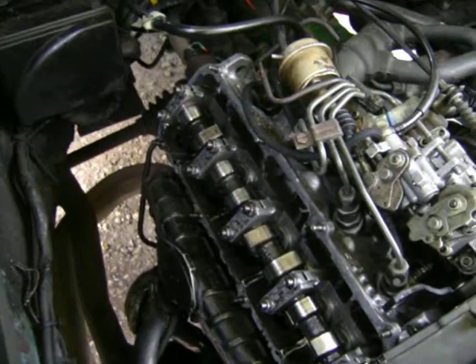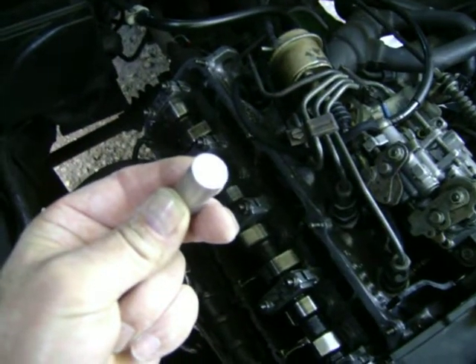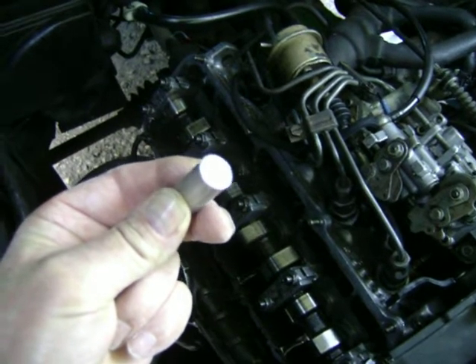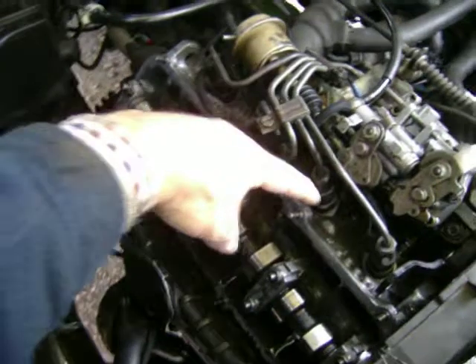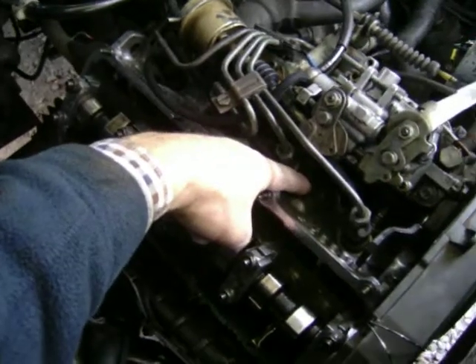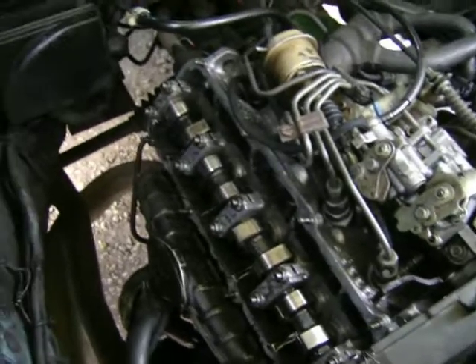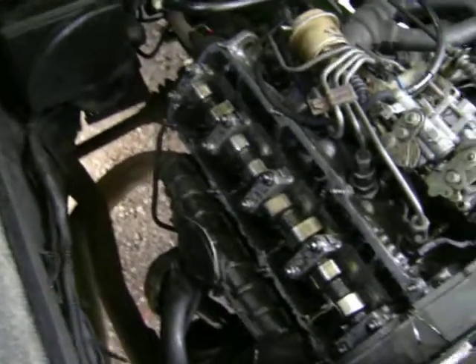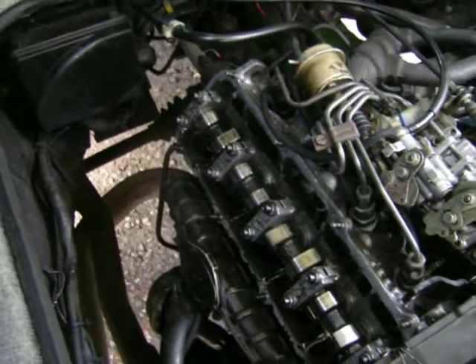So you have to block that off with a piece of aluminum bar, five-eighths of an inch in diameter, which snugly fits in. Then locate it into place by drilling a hole through the front and tapping it with a six millimeter bolt. That supports it, and then get it all skimmed so it's nice and flat with the face of the cylinder head before fitting.